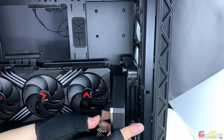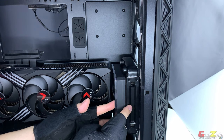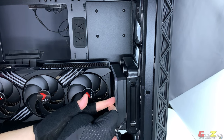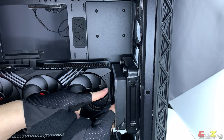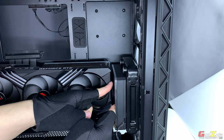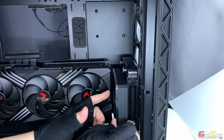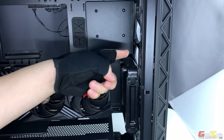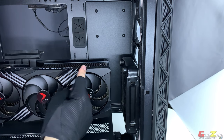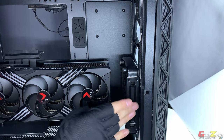If your fans are at the front together with your radiator, take note: the radiator thickness is 27mm and the fan is 25mm, so the total is 52mm. With fans placed this way, the gap to the GPU is almost touching — and this GPU is 332mm, so at 340mm you would definitely hit. An alternative is to place the radiator at the front and fans at the other end to gain more space, but even then do not exceed 350mm GPU length.